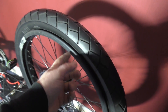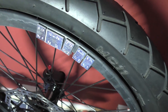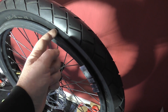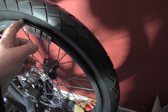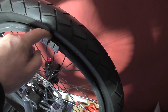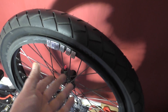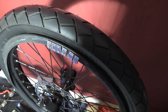You can see how bad this wheel is - that's how much weight I've had to stick on there just to keep it balanced. I've marked the tire and the rim tape so when I take it all back off I know exactly which way to put it. I'm going to take the tire off, stick the weights on the inner valley over the spokes, then put rim tape all around it and then the sealer over that.